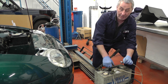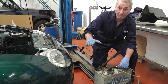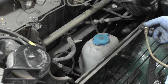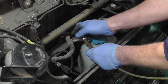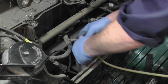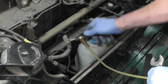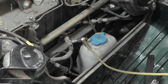This valve on the unit is closed and that holds the pressure. As soon as you open this valve, all the pressure is held in the unit, and then you can use the handle to pump up the suspension, watching the pressure gauge and measuring the suspension at the same time. Connect the union onto the Schrader valve, screw it down, tighten it up with your spanner, and screw down the centre to open the Schrader valve. You'll hear it hit into the pipe, then undo the valve on the unit and we're ready to pump up.